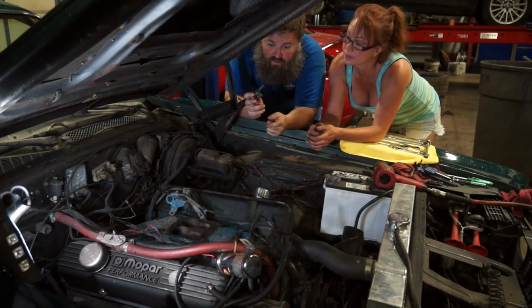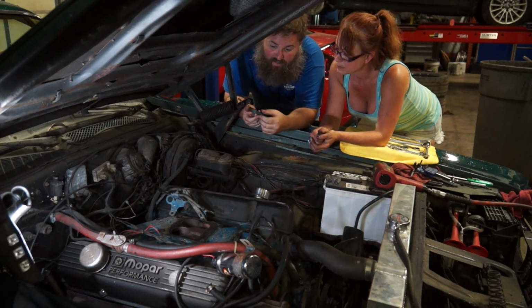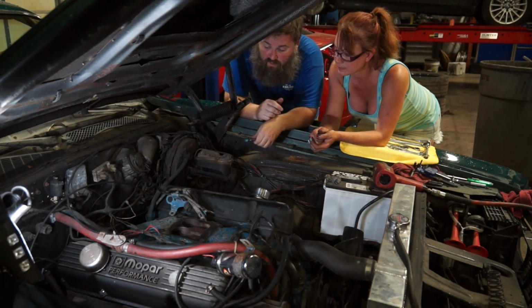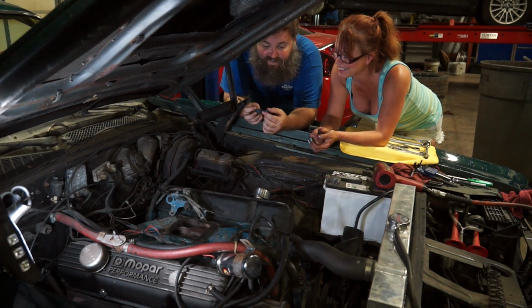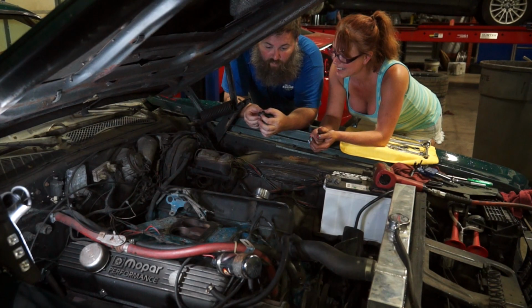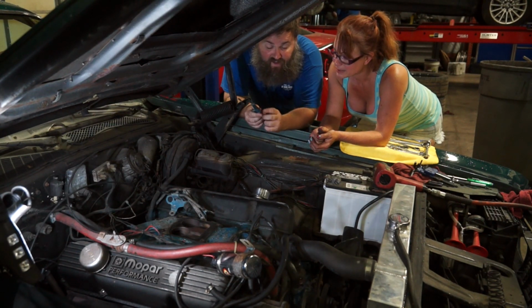Okay. All right, so intake manifold bolts are off. Everything is disconnected. Throttle linkage is all disconnected. This is a last little piece that had to come out of the back, which is a vacuum connector, which runs for a vacuum brake booster. For some particular reason, somebody got a complicated vacuum tee, which has a normal barbed piece, which goes to the vacuum booster, a small little barb, which I have no idea where that's supposed to go or what that's supposed to go to, but it creates a nice little vacuum leak.